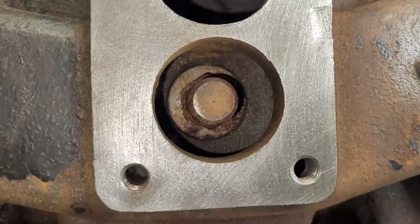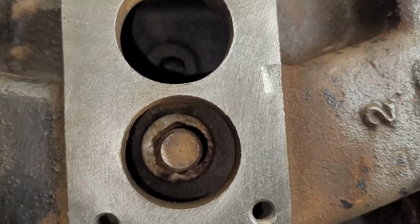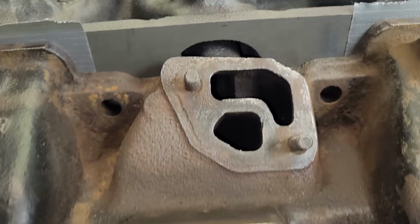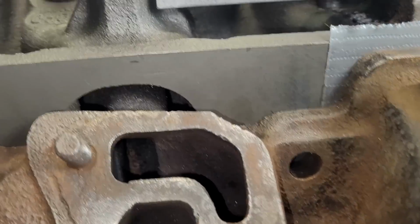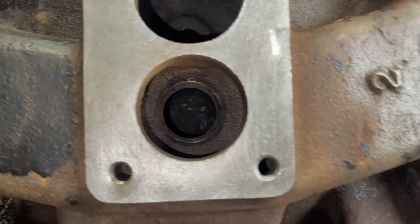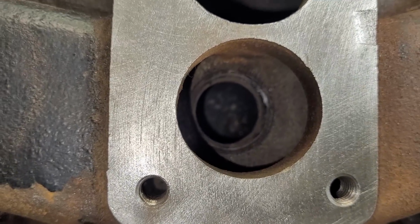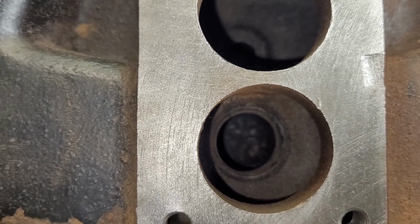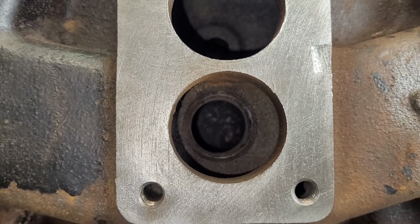Ouch. Okay, first things first is see if we can get this bung out of the center of this little plenum here. Okay, the bung came out no problem. I'm just going to close up my EGR passages. I can't get to that EGR passage unless I pack it with clay. All right, let me figure this out. Okay, I just got to get the right size pipe plug for that boss in the bottom. And if it's recessed a little bit, that won't hurt anything. But I can't find a plug right now for that. So I'm going to try it again with the pipe and then bare manifold.